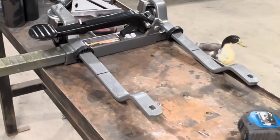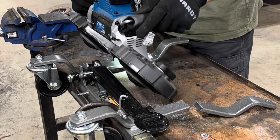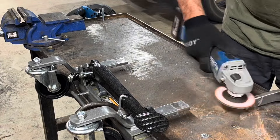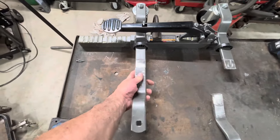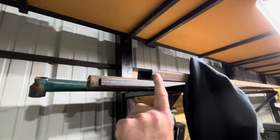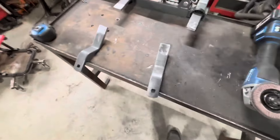So all we've got to do is cut those off, and then we'll clean them up to get ready to weld them. We got those all cleaned up and ready to weld. We could weld it right back together if we wanted to, but we're going to add six inches so we can fit a nice wide 335 tire on there. We're going to use this 1 by 2, 120 wall tubing along with this quarter inch by 4 inch plate that we're going to cut in half - basically to 1 inch 700 for each one - and that'll fill the gap between the half inch of that piece and the about three-quarter inch inside diameter of that.